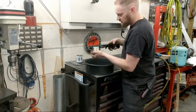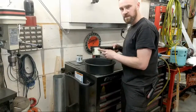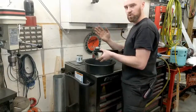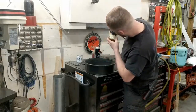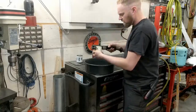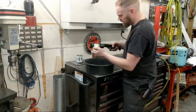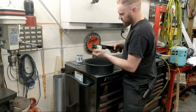And now we'll actually see the quality of the oil too. Oh, I do want to note, this had low oil pressure. I did not like the oil pressure. Every time I revved it up, the oil pressure would not increase with this filter. I think this is the filter, unless that was the guy with the Pennzoil. I don't know, I do too many jobs. I can never remember. But this filter here, I believe, was the one that was restricted and why I ended up suggesting the flush.